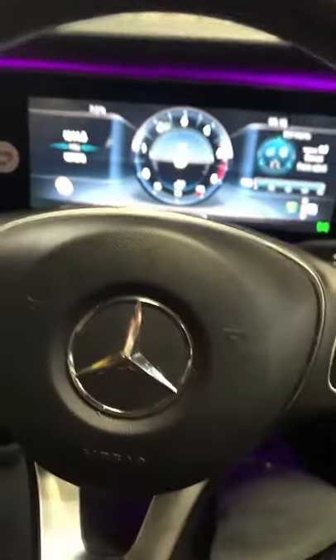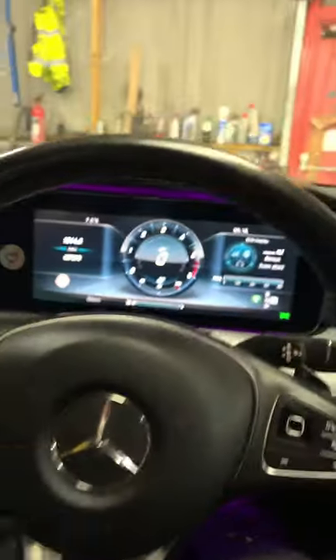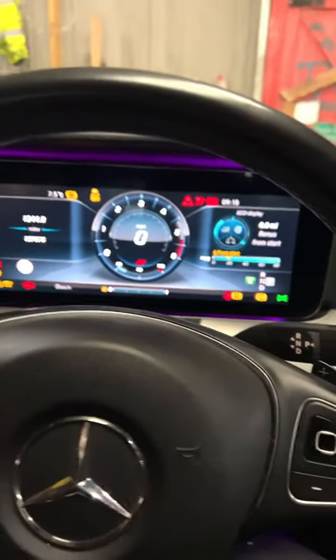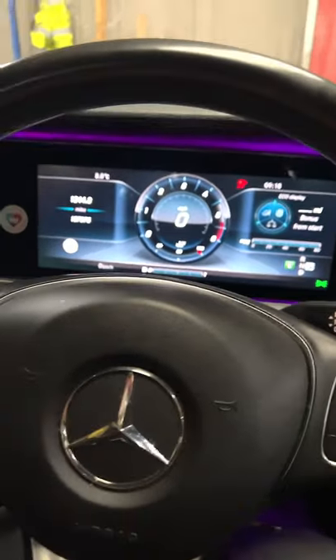What I've done is already released the handbrake. To release the handbrake, you switch the ignition on, release the handbrake, switch the ignition off. It's right here. All you then do is put the ignition to key position one — you just press it once.